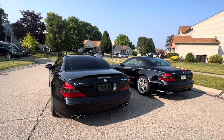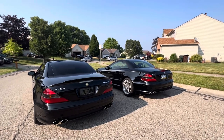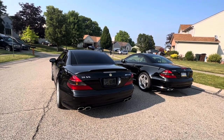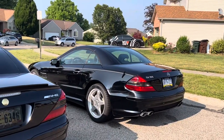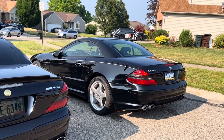I also wanted to see the difference between the two. If you're just daily driving your car, if you're not doing anything crazy with your car, just go with the standard default spring. It's perfect. It's a nice setting, a nice option, nice adaptability. 28 dampening settings. On this one, I have it set up right now with 24 in the front towards firm and 18 in the rear.